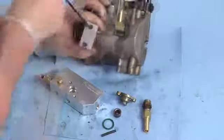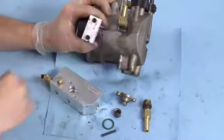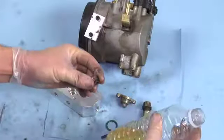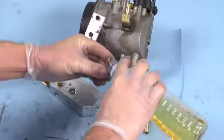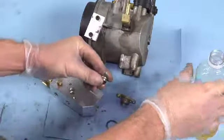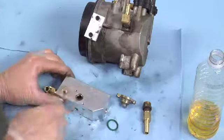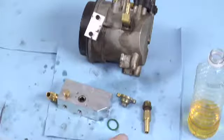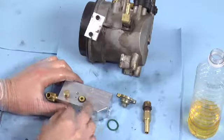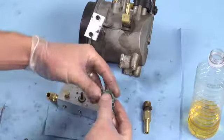The pressure regulator taken out of the stock diesel filter will now be placed in the Greasecar fuel manifold. Using clean vegetable oil, lubricate the part to provide easy installation. Place the valve basket into the fuel manifold. Place the valve spring and plunger into the valve basket. Spring in. Next, place the valve cover over the spring and plunger.